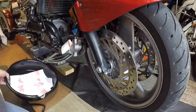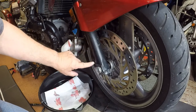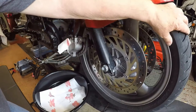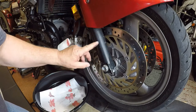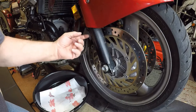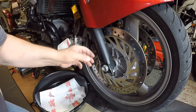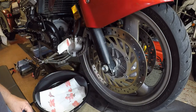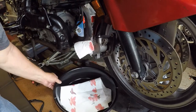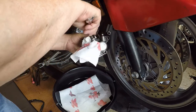Something else I like: right here is the plug for the oil in your front forks. You can change that oil — you have to get the top off, then take this out and drain it. The book will say how much oil goes in, and it'll say wet or dry. Wet means you're just draining and putting new fluid in; if you tore them down completely to rebuild, they'd be all dry inside so it would take more oil. Now I'll find the 12mm wrench and break the banjo bolt loose — that's where the brake line goes on.